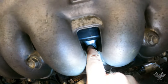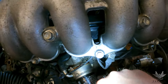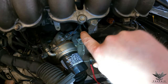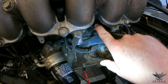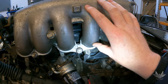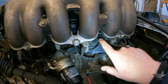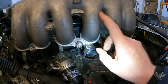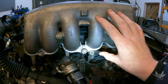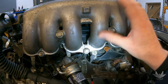The little plastic has a chute that goes through there, so when you're putting the plastic on, remember to push all these plugs through that cavity. Coming out here, first we go to our earth which bolts on over there. Next is the ACIS valve. I haven't got a video on the JZ ACIS yet — put some comments below if you want one. In the interim, I've got a video on a 1UZ and 3UZ that has the same type of system, so I'll put that link up there. It's called acoustic control induction system — just a fancy term for variable intake runner length.